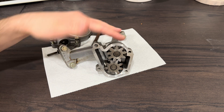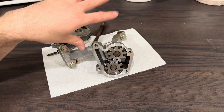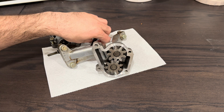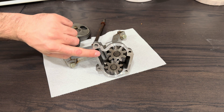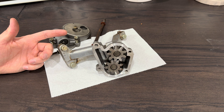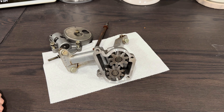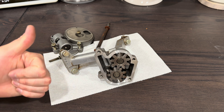It's good practice when you put these back together — get the motor all built, fill it with oil, and then before you set your timing fully, put a drill on the actual cam drive that turns this and spin over the pump until you get oil pressure, until you see oil go up to the top of the cylinder head. Other than that, happy motoring. Go ahead and inspect your oil pumps and throw them back in your car. Let them do some more service. Thanks again for watching, and we'll see you on the next one.